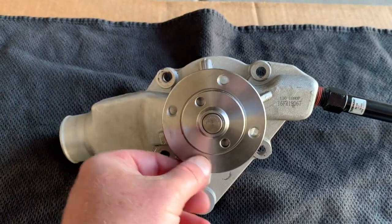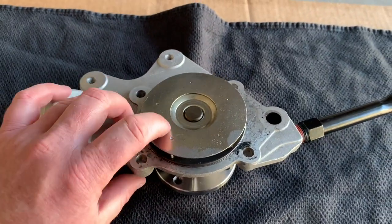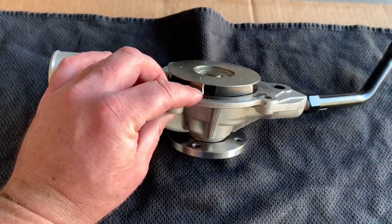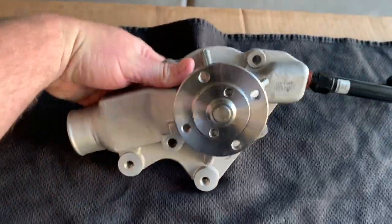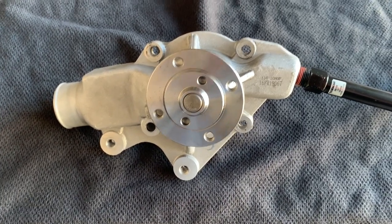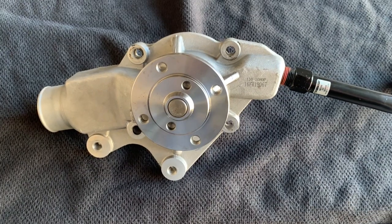You can feel a little bit of tension — there's no visible problem. But you don't see the other side unless you pull it off and realize every single one of the fins is completely gone and the plate is completely deteriorated. This is a very common and very overlooked problem in the XJs. Make sure you're paying attention to this one. It is a little bit of work to pull it out, but nothing that won't take you about an hour.